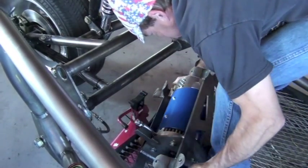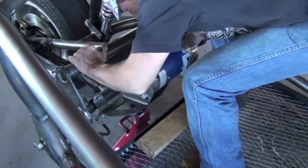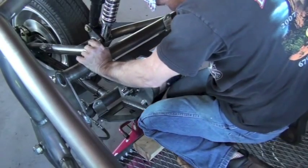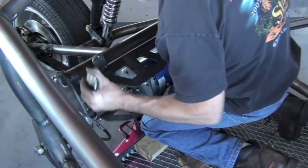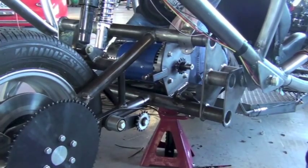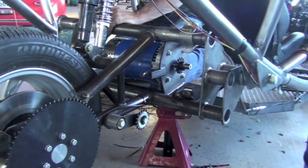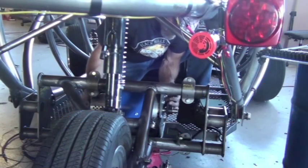The first step is to put the subassembly into position with its brackets on the frame of the swing arm. We're not going to worry about alignment at this point, but you can see the motor resting on the jack stand and the brackets lined up on the swing arm frame. We'll begin to attach the back end of the brackets, starting with the top brackets to hold the swing arm and the motor subassembly together. Then we'll align and attach the bottom brackets — top brackets first, then the lower brackets.